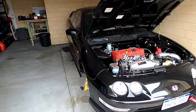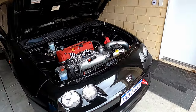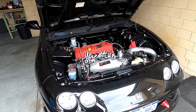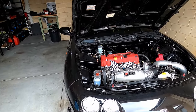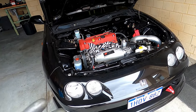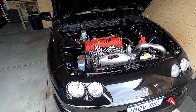The car's up on stands and I've pulled out the fuel system. First thing I actually did was a compression test on the engine — that was all good. They're perfectly even within about one PSI across all four cylinders, so that's really good. One thing I was worried about with the lean misfiring is potentially burning a hole in a piston or compromising something in the engine, so far so good — we'll see how it holds up.